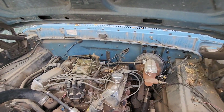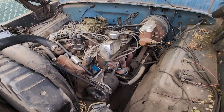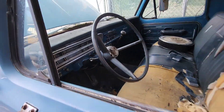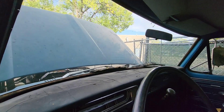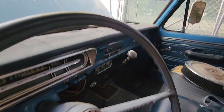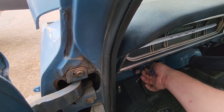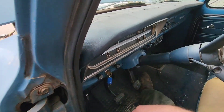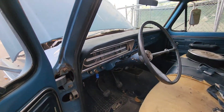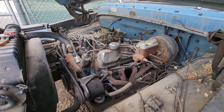So it's probably going to light right off - if anything, this might be a little flooded out. I'm actually not even going to pump it because we're not going to have any fuel squirt yet. Let's give it a little crank on the key. Seems flooded - a little too much fuel. So let's hold her wide open a sec. Yep, a little flooded from dripping too much down the throat of the carb, but hey, now she's idling - idling fairly smooth, actually.